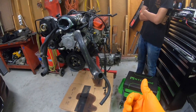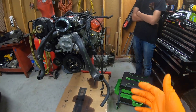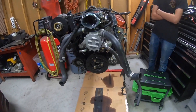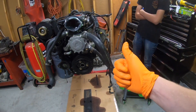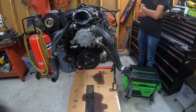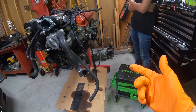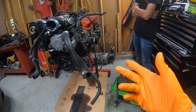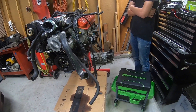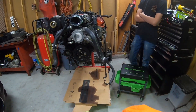On the bottom end, the plan is to make it safe enough to rev that high and accommodate the high-revving cam while still making good bottom-end power. We're replacing the crankshaft — I'll show you what happened to it during the teardown, but one of the bearings completely failed. I'm also doing an inspection on the rods and pistons to check for any damage from metal that got into the rest of the engine — assessing what needs to be cleaned and what needs to be replaced. The whole block needs to be stripped and cleaned.